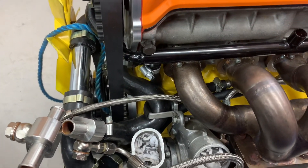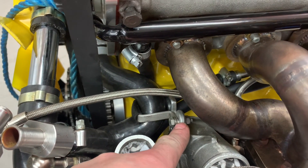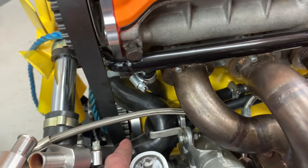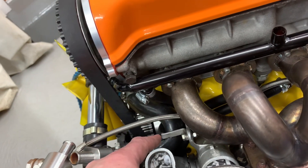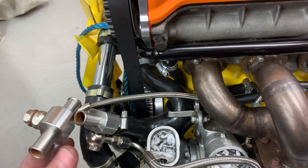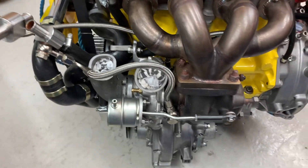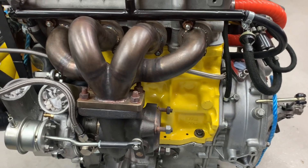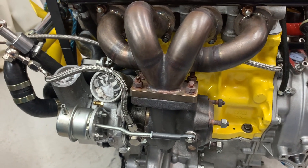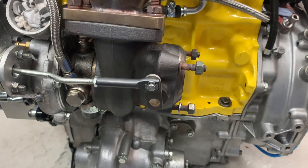The engine is now ready to go back in. I've put the padded clamp I made — that's why I've left that bracket on, it's good for mounting things on. It mounts this little padded clamp which just holds the top radiator hose out of the way, because when everything's in the engine bay it tries to force its way towards the cam belt. Everything's tight; I've gone along every single bolt. There were one or two that had the tiniest nip needed but generally I tighten things up as I go along — that's how you avoid things coming loose when you don't want them to.